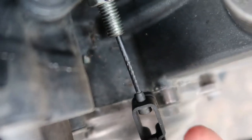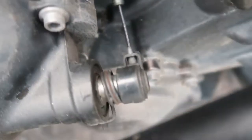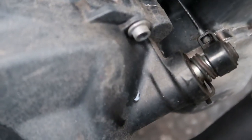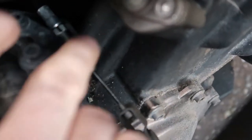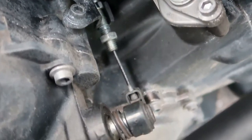First step is to loosen off the nuts at the bottom end. The other side of this cable grommet there's a little bit of black metal that bends out of the way, and basically I'll bend that out of the way and then the grommet goes down towards the engine to get off the bike. First I need to undo this nut, which is a 12mm. Now that's loose enough that it can be unhooked.